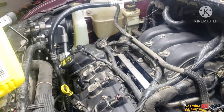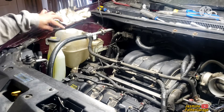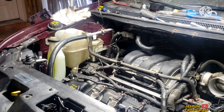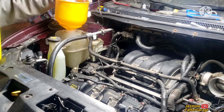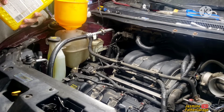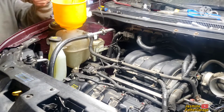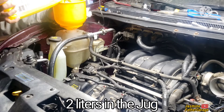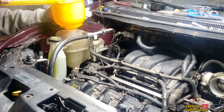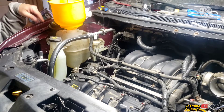The service information said 10 to 10.5 liters if it's bone dry, so I have enough fluid. We're gonna fill this bottle all the way to the top — it's gonna need more than six liters. We're pouring the coolant concentrate in first, then the water right after. You can tell this system is thirsty because it needs more.